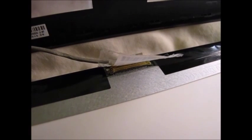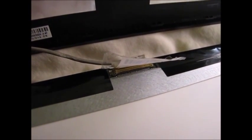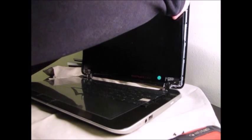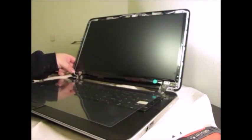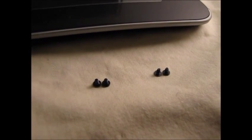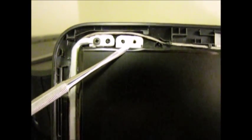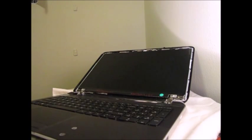I have it hooked back up. I'm going to go ahead and put that sticker down and then start fitting the screen back into place so I can screw it in. You should still have four screws that hold the screen in, and they will go right here, here, here, and right there. The screws are in place and the screen is pretty stabilized. The next thing I'm going to do is put the plastic casing back on top of the screen.